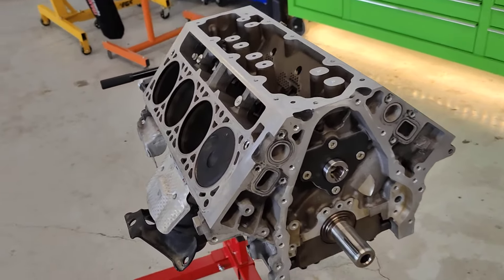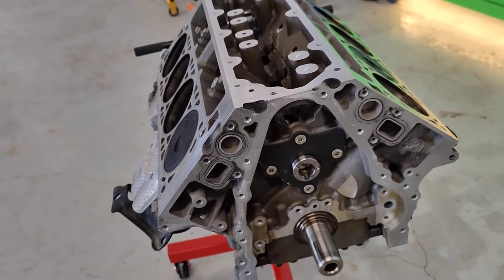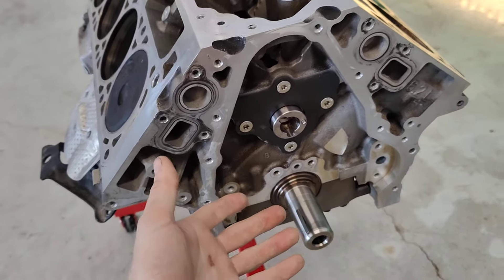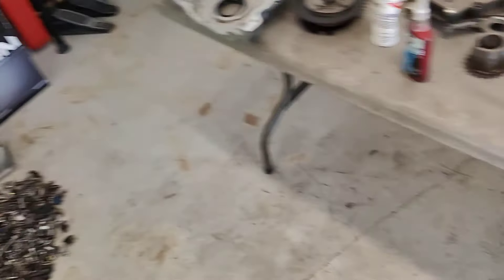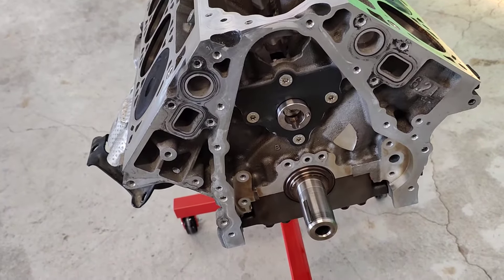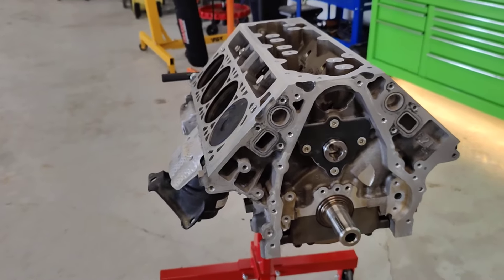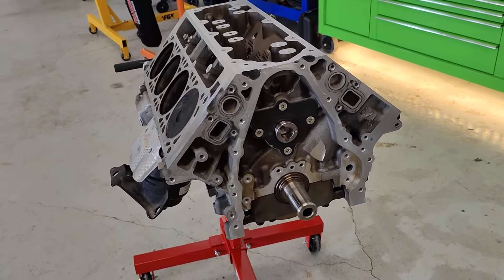This service can be done with the engine in the vehicle, but I like to do it with the engine out because it makes it a lot easier to get to the oil pan. Your front cover as well as your entire oil pan are RTV sealed with a special gray RTV sealant. Getting it on and off with the engine in the vehicle is a real pain because you really have to clean and scrape all the gasket surfaces well. So I like doing it out of the vehicle — you don't have to, but it definitely helps.